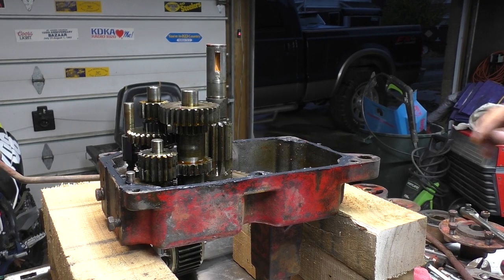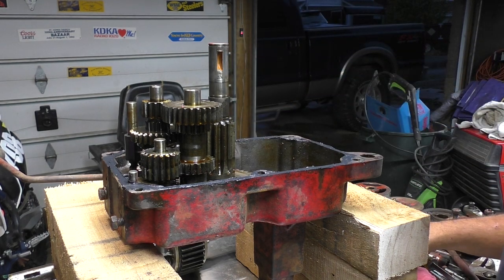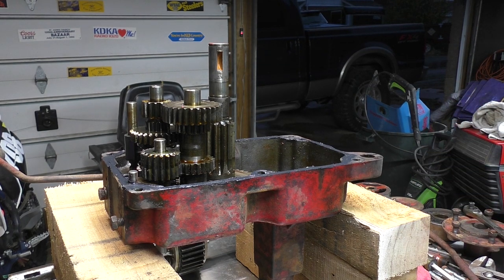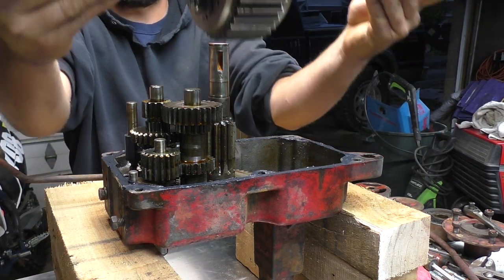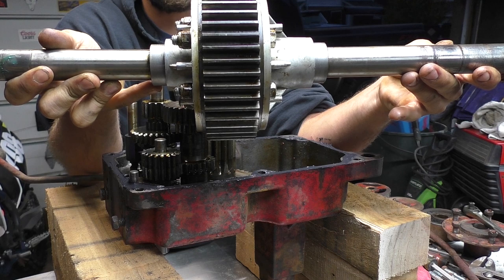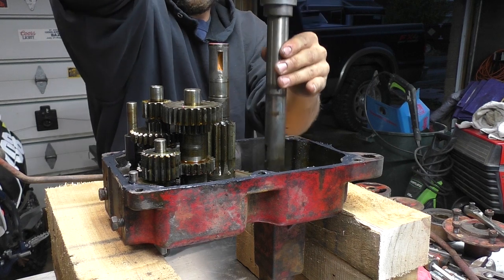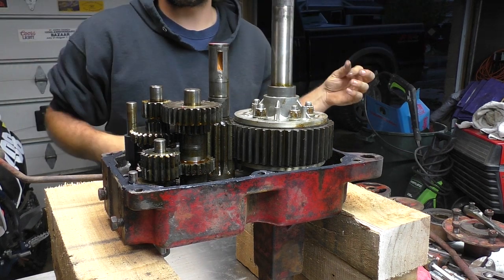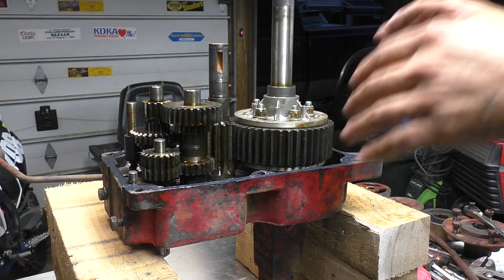I do have RTV silicone sealant around the gasket edge — you can purchase a new gasket, but I'm not that kind of person on something like this. When you took it apart, there are two different lengths to the axle. The carrier on the left side is shorter than the one on the right — the longer one is going to go downwards. Slide it in and make sure it seats properly, then get your other case half and put it on.